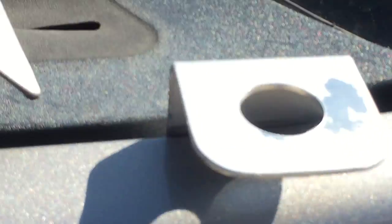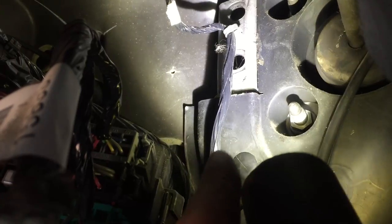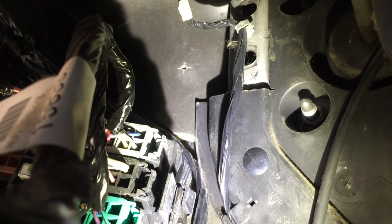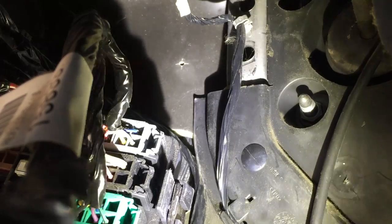If you come on the cabin side, this is my CB radio mount that I'm going to use that hole for. There is a fuse box here, and this is the brake pedal. This is the cover you will find here that covers this box. Right where my finger is pointing — that hole came with the truck; I did not drill that hole. It's a pre-drilled hole through the foam, and it corresponds to the dimple I showed you on the other side. So that's where you should be drilling if you're planning on running wires through.